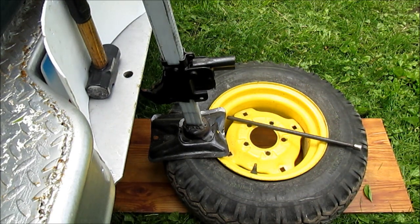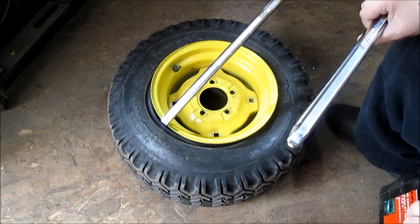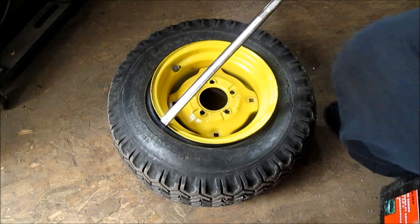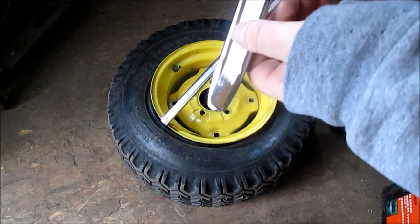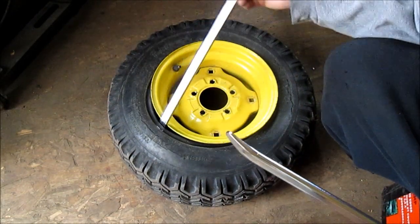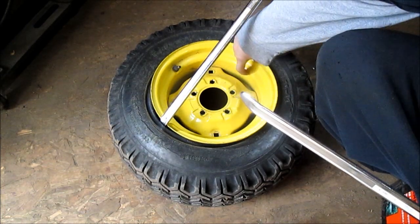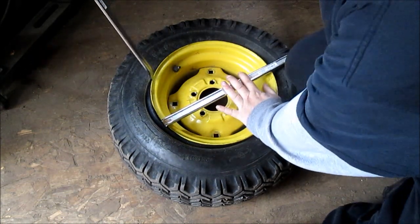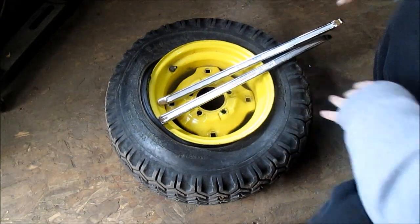Okay, we're moving on inside — it is muddy out there. These are Harbor Freight tire irons and they are way better than what the picture on the website shows. Trust me, they're way smoother. Here's one end, which I have hooked over the tire. See this step in the rim — make sure you have your tire down below that step, right in here. They usually come out better on the front side. We're going to use not the hook end but the other end.